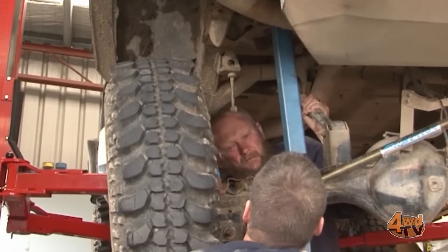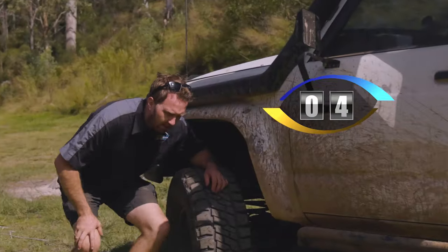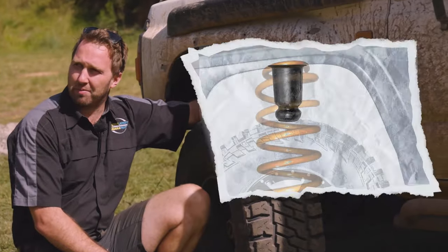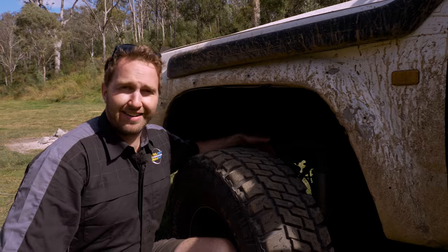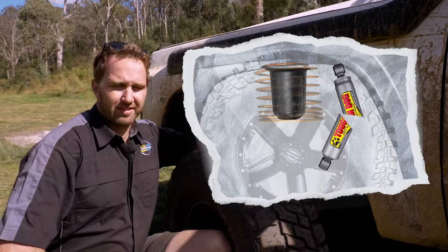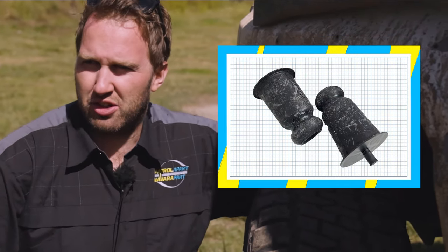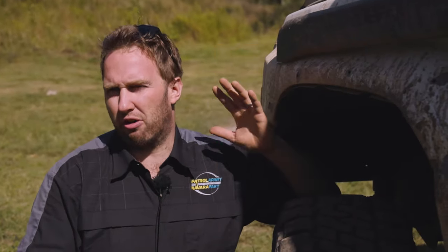It's easy to check yourself — have a look around the coil towers for any cracking, look for stress marks along the bottom edge of the chassis where the bump stops bolt, up and down the edges of the coil tower, and look around the top of the coil tower for cracks. Next on my list is the front bump stops. So many times I see cars come through the shop or out on the tracks missing half the bump stop, and most people don't even realise it's missing — because when it breaks, the bottom half falls off completely. The problem is it allows the diff to compress up too far and the shock absorbers will bottom out, doing heaps of damage to products you've spent good money on. You can put a genuine replacement in, an aftermarket version, or an upgraded unit that's longer and stronger for a more progressive rate of bump as you come down onto the bump stop.